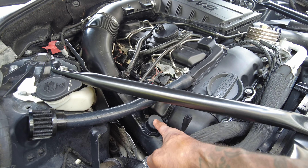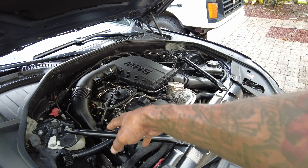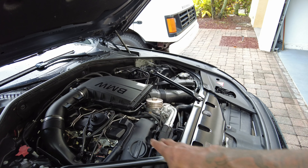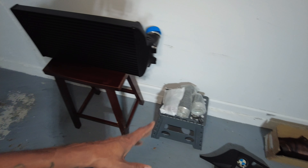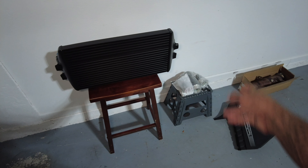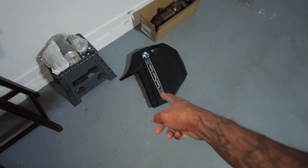I'm redoing my positive crankcase ventilation system. There's also a silicone plug here, and it's very tight. I don't want to give too much info on this setup because there are a lot more pieces that go with it. But it's going to stop all that nasty oil from infiltrating the intake and turbo tract and gumming up your valves — so you'll never have to clean the valves again. These are the other parts I need to install: the front mount intercooler and the boost pipe. She already has the charge pipe upgraded and the downpipe. I want to have these installed before I put the tune on — I don't want to push her more than needed with the stock intercooler, knowing it's full of oil.